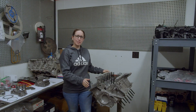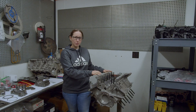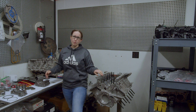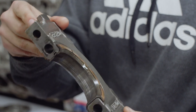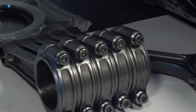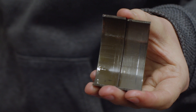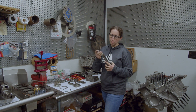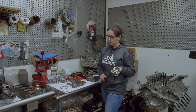When it comes to the block, check the cylinder bores and measure them out. For the bearings — on the main bearings you can see a little bit of crank flex but nothing major, nothing crazy. Check the thrust to make sure the crank isn't moving forward and back. When you pull the rods out, make sure they're straight and check all the bearings. These look brand new with the coating still on them — a good sign that nothing crazy was going on with the rods. Also check the pin fit at the rod end for tight tolerances.